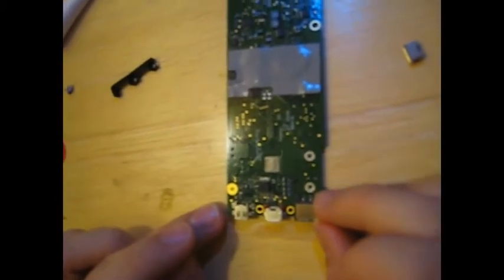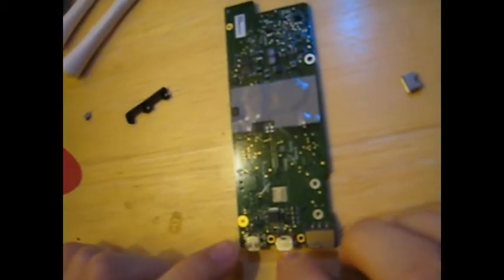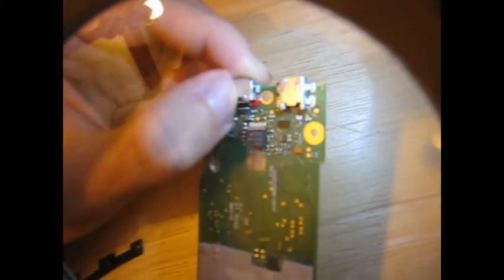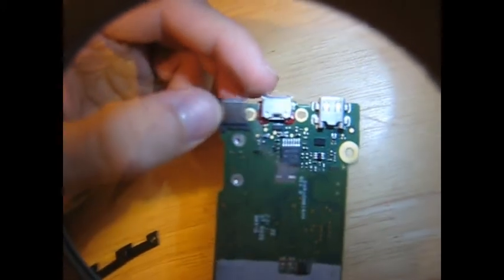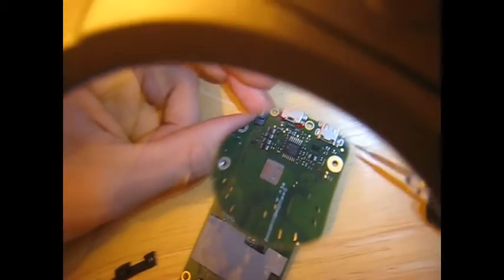So now we're going to go ahead and try to desolder this connector. On the main board holding the USB port in place — I don't know if you can see that — it's red. That's solder mask. That stuff has to be ground off; it can't be soldered off. So I got a little $12 grinder from Walmart — it's the cheapest grinder in the world — and we're going to be grinding it off very carefully.